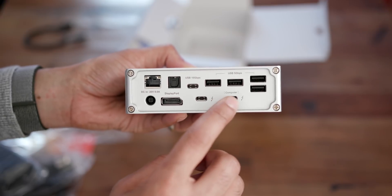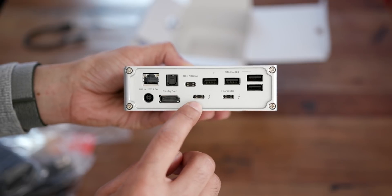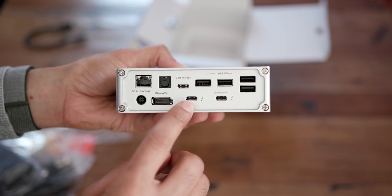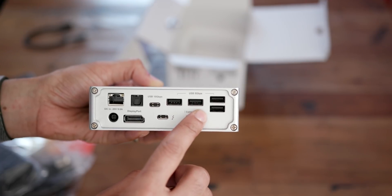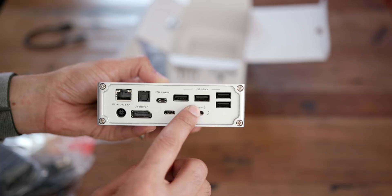You can connect to your iMac Pro, iMac, or MacBook Pro. There's a second Thunderbolt 3 port for daisy chaining or for connecting an external monitor like the LG 5K display. And then you have four USB 3.1 Gen 1 ports — 5 gigabits per second — all four of them on the rear.